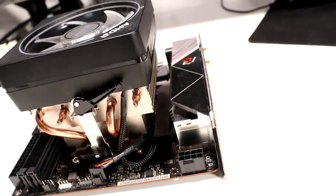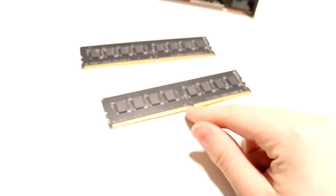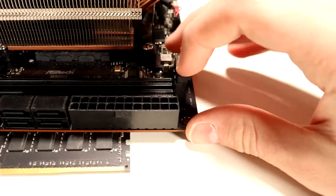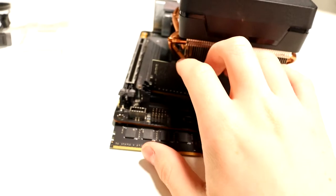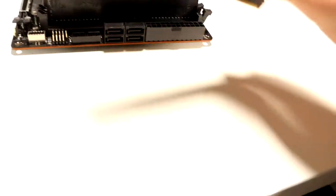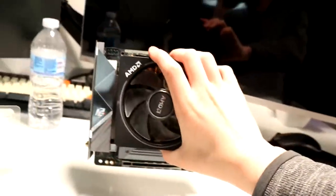Now we can go ahead and install our RAM. We got 16 gigs — I think 3,200 megahertz. The guy that sold the RAM to me kind of pulled a fast one on me and didn't include the little heat sinks, but it should be fine. Let's go ahead and install these. We're going to align them with the little slots, plop them down — you hear a little click. Now nothing comes out. There's the other one hiding under it. Plop this one in too. It looks pretty good — that's basically the whole motherboard. That's a lot of computer right there.